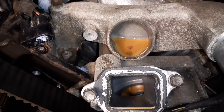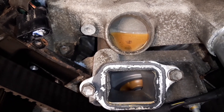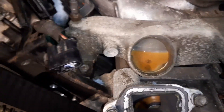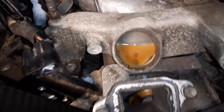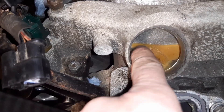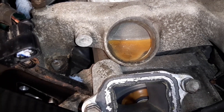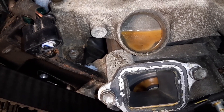It's also been a couple of days since I drained the coolant system - I drained the radiator and both cylinder banks. In the end you saw this milky rust-like substance coming out, and it settled down in here now. It seems to be some kind of rust from an iron part somewhere in the cooling system. But on top is clear fluid, so there was no oil getting into the cooling system - another thing that makes me hopeful.